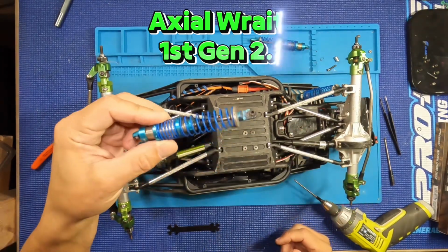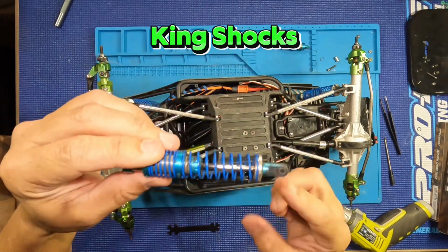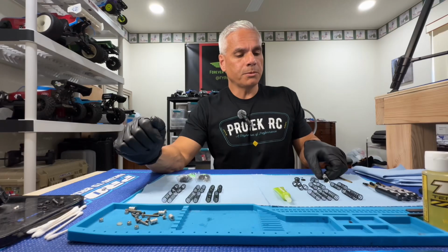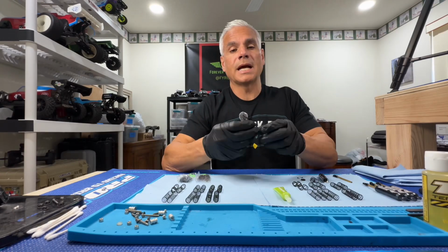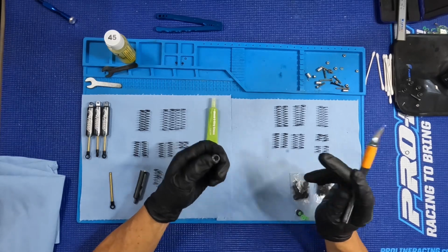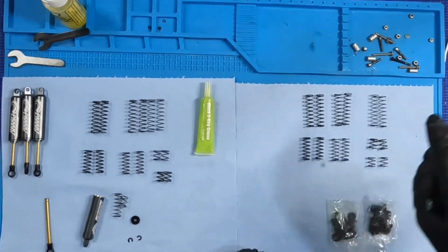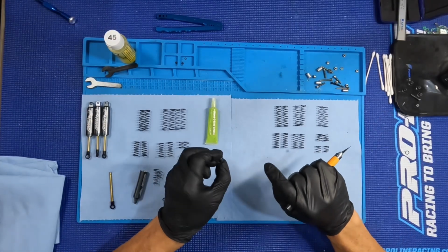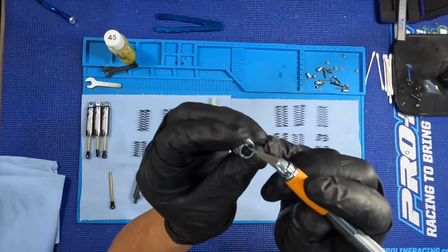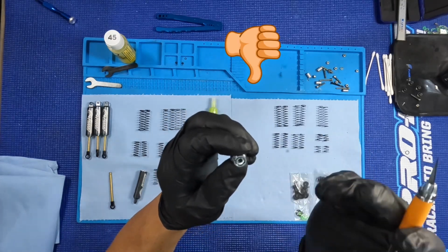These things are so dirty, so oily. I really haven't done them in a long time, so I've got to clean these off and redo these. I'm going to show you one problem that I can see: get this apart and get all these little O-rings out, to put this Losi green slime O-ring grease in everything where I want it. There's a little clip right here. You have to take this out, release this, and everything comes out.